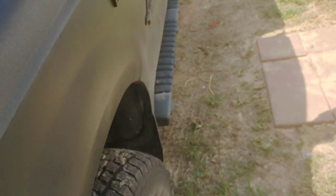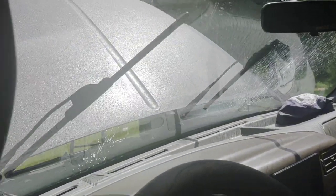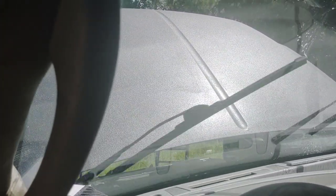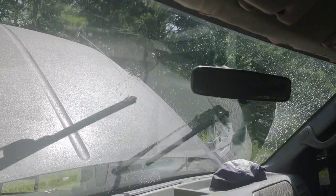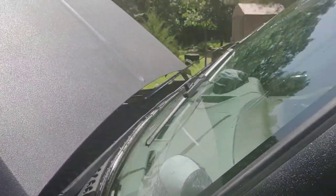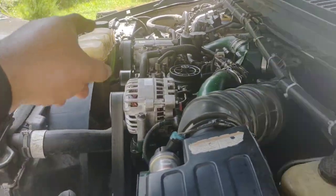So let's see if these washers work — should just be as simple as pushing the button. Yep, the key is on. There we go! I think I may need to replace the driver's side spray nozzle. As you can see, the passenger side's got plenty of spray to it, but it's pretty dry on my side over here. A lot of people don't know that the power supply to the pump washer is supplied through the wiper motor.